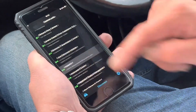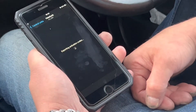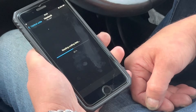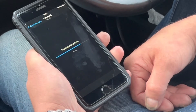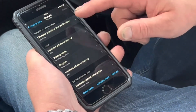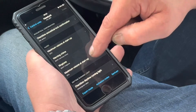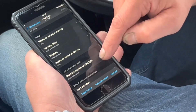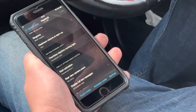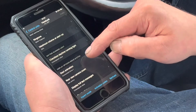Today we're going to do the head unit M logo, so we select the head unit. That'll load up with the car and make sure it's logged on to all the relevant devices — takes a little while, but not as long as the initial load. These are all your options on your head unit. Importantly, whenever you do any coding it always takes a backup, so if you mess it up you can always go back to the way it was.